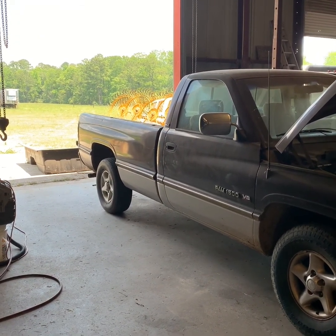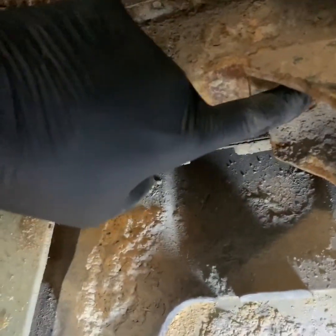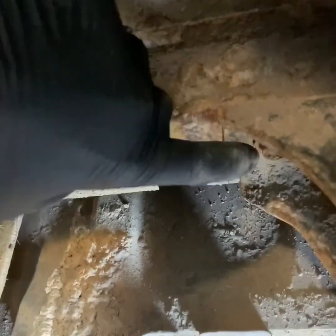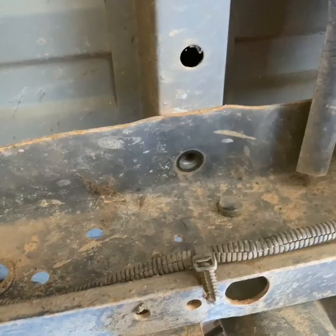the fuel pump. First thing you need to do is get under the vehicle, and up near the front of the bed under the vehicle there's two bolts that are mounted to these brackets that are mounted to the frame, and these bolts have 15mm heads on them. You got to take these two bolts out on this side and then take the two bolts out on the other side, and then we'll move to the rear of the truck.